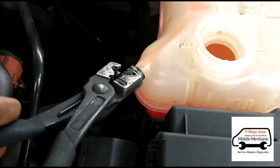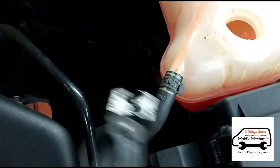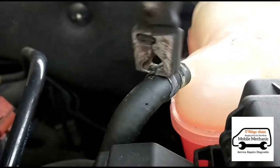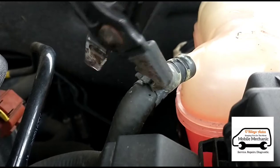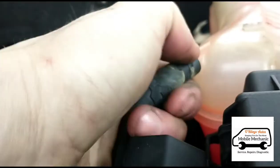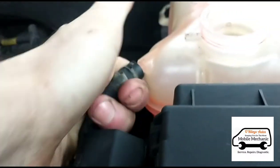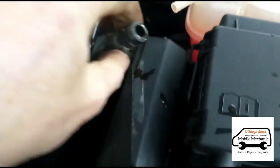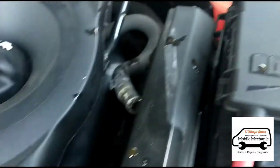On the bottle there are one and two hoses going into it, so they just need to be opened. We'll use a pair of pliers to take the clips off and then pull the hoses off — just give them a little twist left and right. We will lose a small bit of coolant while doing this.